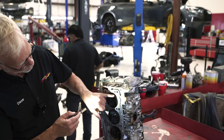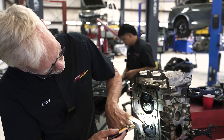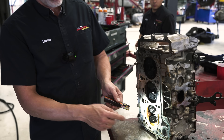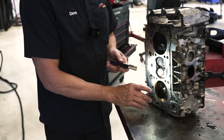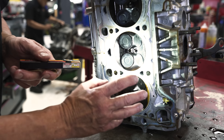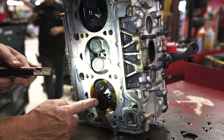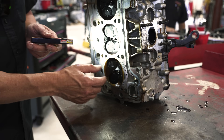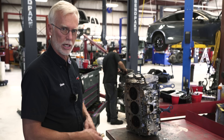See how this has got carbon? It's all dark in this area, and this is all dark here - a lot of carbon. We call that oil wash. Now, if that was a blown head gasket, it would be steam cleaned. It wouldn't be brown like that - it would be as clean as the aluminum here. But this is oil wash. So if you ever pull a plug out or bore scope a hole and you see that, you're burning oil up through the rings.